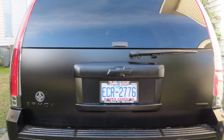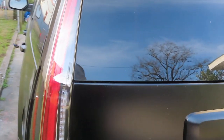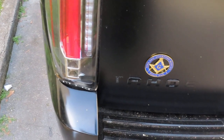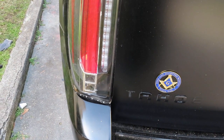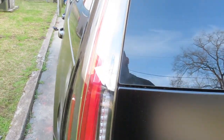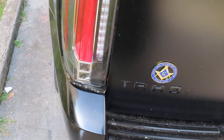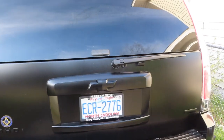What I had to do was get the running lights and the brake lights going on the main light. But if you look down here, I have a strip — I'm going to do something a little different with it — but the strip is for my turn signal. So my turn signal is not on my actual light, I had to wire it down here separately. That way I'm able to get everything — all functionality.